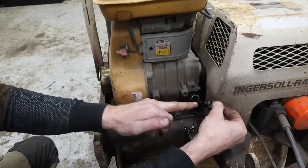All right, what should we do next? I'm kind of thinking we look in the fuel tank, see what we see there, and then maybe head into the carburetor and try to figure out if that's going to be clean or dirty. So let's get a light and we'll look down in the gas tank. Oh, nice. Even got the old strainer screen in there. It's actually pretty clean.